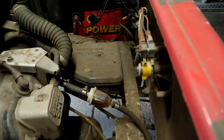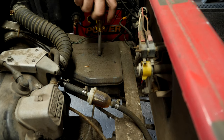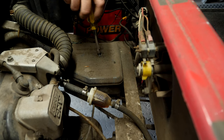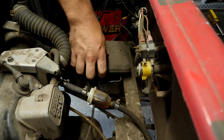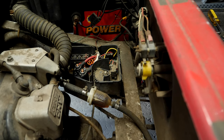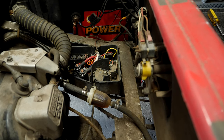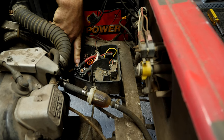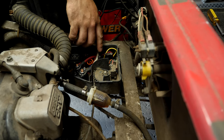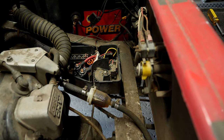What we're going to do is take our voltmeter - multimeter - set it for the 20-volt range DC. We're then going to take a 5/16ths nut driver. Depending on your cart, this may vary. As you can see in here, we have our solenoid right here - also known as a contactor.